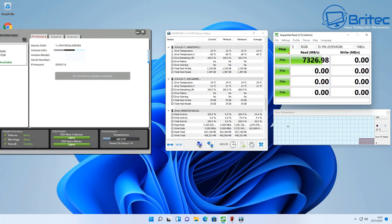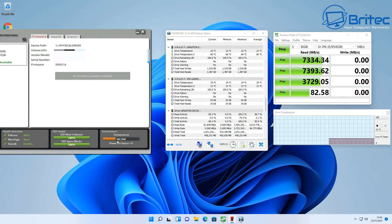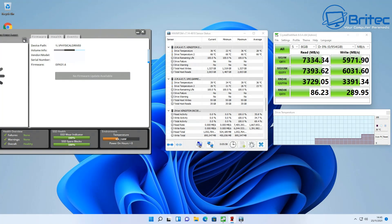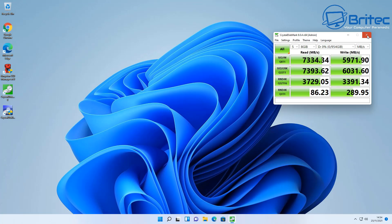There is going to be heat going into the drive during the benchmark. You can see it's up to 36 Celsius — literally about half of what it was before. Running it all the way through, we only got to 43 degrees Celsius, which is quite a big drop compared to the 61 degrees before. Depending on what you're doing, if you can take 20 degrees Celsius off your drive, that's a win. After a few minutes the temperature dropped right down to 30 Celsius — running nice and cool.